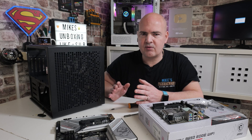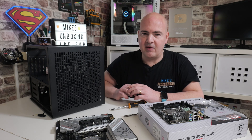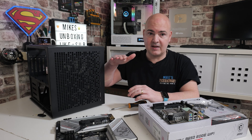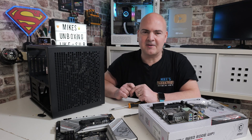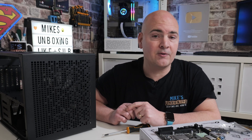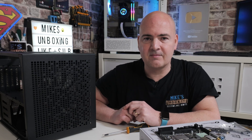Hopefully this video has gone some way to educate and inform you of the different variations of the layouts from motherboards, and potentially if you've got a PC which hasn't been able to boot, this might have been the problem. You can also find an easy way to tell — if you're going to put your PCI Express cards in and for some reason the screws aren't lining up and you can't fix your graphics card in because the motherboard is sitting about 5 to 10 millimeters lower than it should be, that's pretty much a giveaway. So do check those pillars. Hopefully you've enjoyed this video — if you have, smash that like button, consider hitting subscribe and the notification bell. I've been Mike from Mike's Unboxing Reviews and How To — hopefully we'll catch you in the very next video. Thanks for watching.